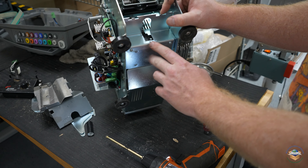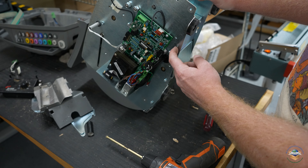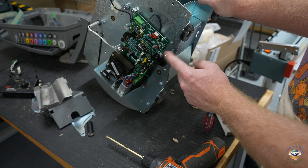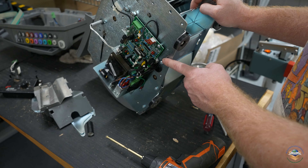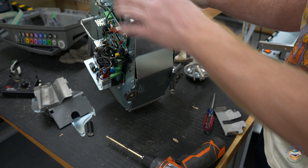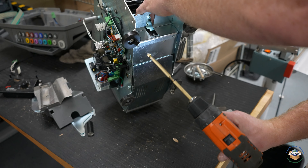Another thing I'll take off is this plate here. If you've got an older machine you may find this is all one plate, and there are divots where it sits into the side frame. One of the improvements they've made is removing those divots so you can access and do this repair. If you've got an older machine it's real difficult to do this and it's not something I'd recommend. If you've got a newer machine and it's got a plate where it's two pieces, you can do what I'm doing here. I'll start by taking these two screws out with the power drill, but I recommend using a hand screw to get them back in.